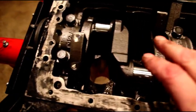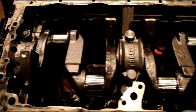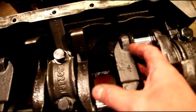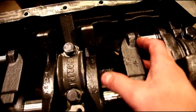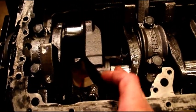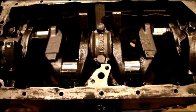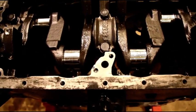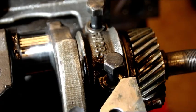I'm going to pull these caps to show you what I found when I took them off. The crankshaft is rough — you can hear my nail catching on it. Let me get set up and show you what we found when I took those off. Let's pop off this front main cap.